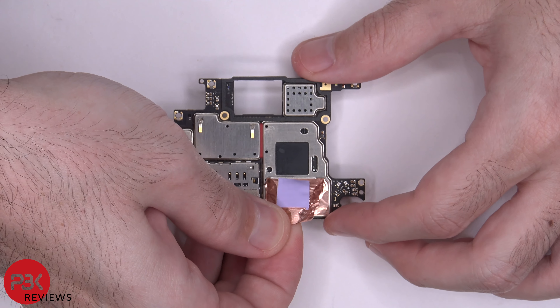Here's a better look at that — you have a charger port and a headphone jack. Now, in order to remove the battery, there are no pull tabs to remove the adhesive underneath, so you're going to have to gently heat the battery and use a plastic pry tool to gently pry it off.